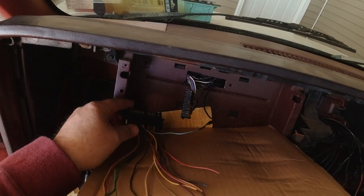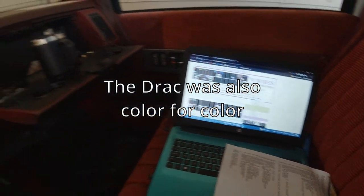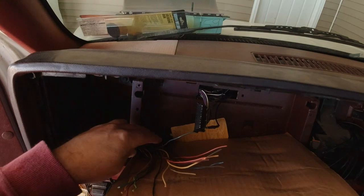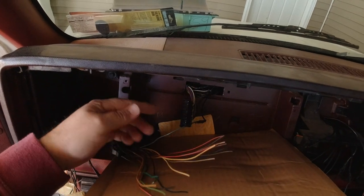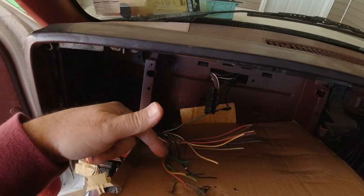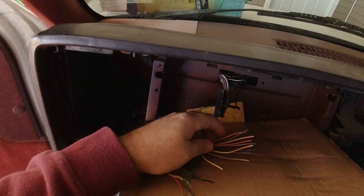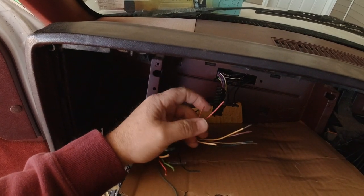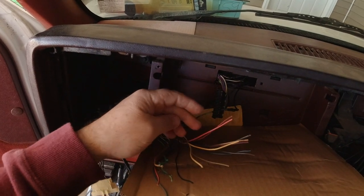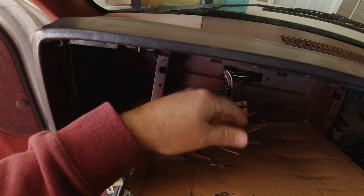I'm going by this wiring diagram: red wire to red, red-and-white to red-and-white. I've also found that this pin should be located in position two, not position one. All my DRAC wires are wired in and shrink-wrapped, and now I'm ready to start the main plug conversion — color for color. This plug may have daytime running lights, which I don't have, so that wire just won't be connected. There are two pink wires here that go to one, and two black wires to one; everything else should be one-to-one.